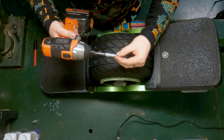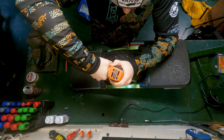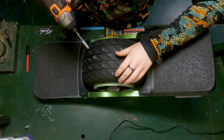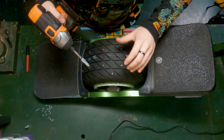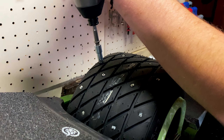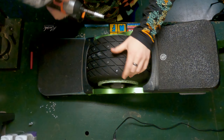Alright, so you've got your stud and your drill. You're going to fit the bit in there, line it up on your mark, and you're going to have to apply a little bit of pressure and start drilling it in. I like to check as I go because I don't want to sink it too far — there were a couple I sunk a little too far in and you kind of tear up the tire trying to get it out. You just want the shoulder of the stud to be embedded into the tire a little bit.